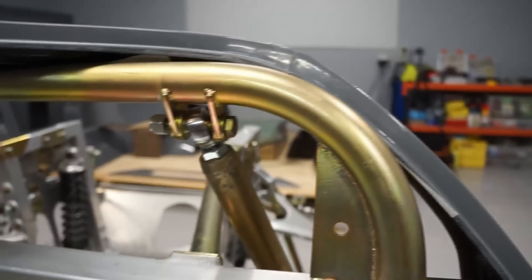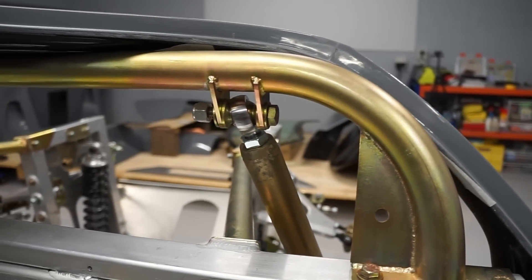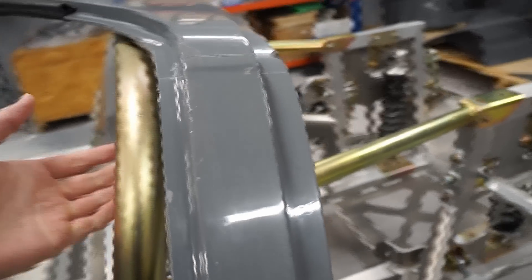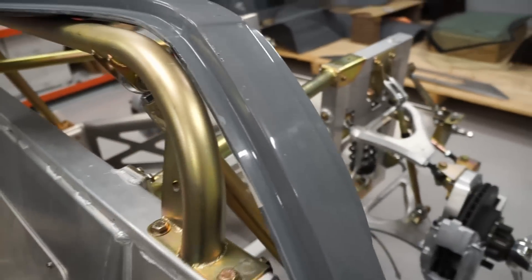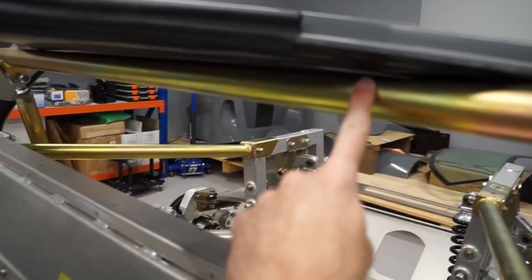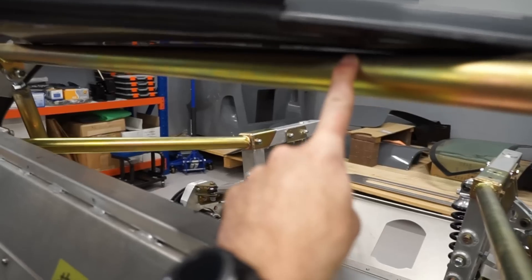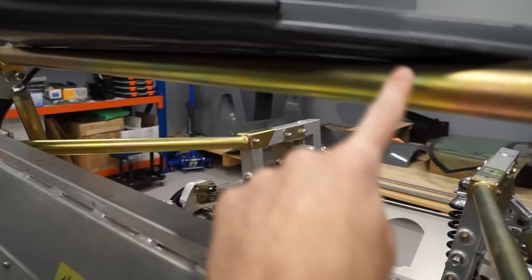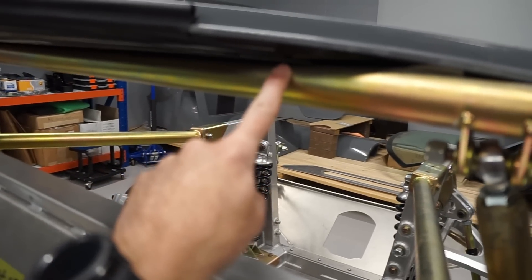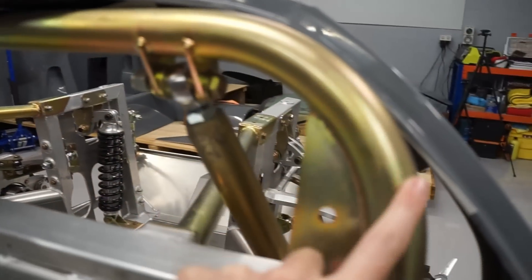If I have a look from the front you can see here where the corner of the roll bar protrudes up higher than the lip on the spider. Essentially this roll bar needs to sit inside this section but because it's got a flat panel underneath, that needs to be trimmed to allow the roll bar to pop through. It's pretty hard to show on camera but you can see there's a little air gap, which means we won't have to trim the full length of the spider panel.